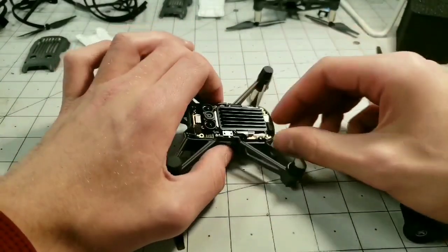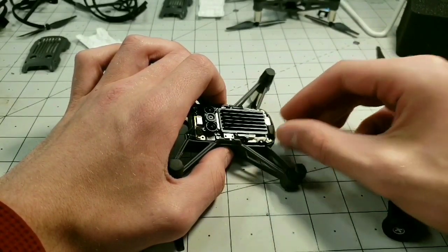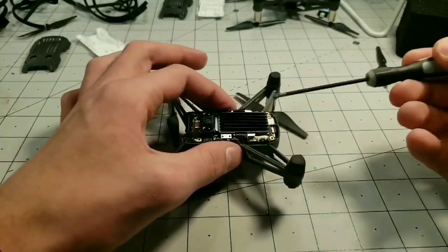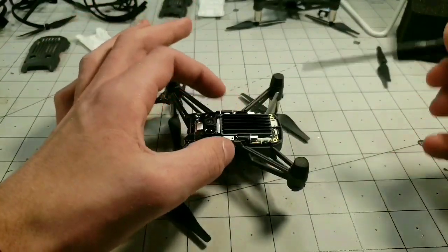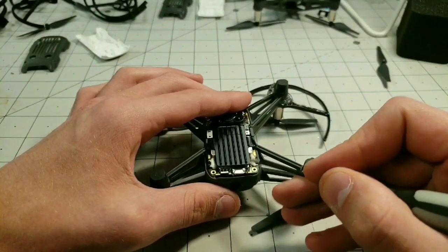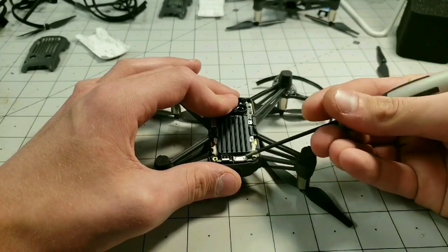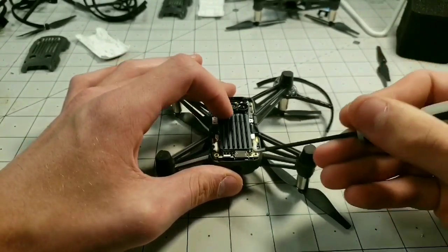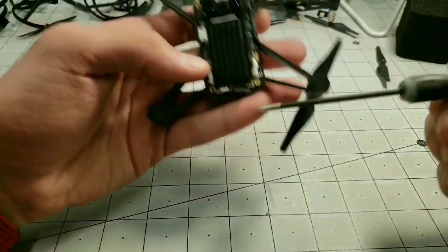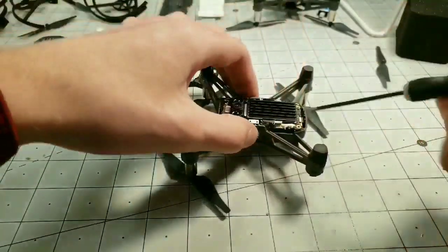Once you get that glue cleared, go ahead and take this little rubber piece that goes right next to the camera — it's a little electronic piece — and put that with your screws as well. There's a heat sink right here. The only thing we want to do before we lift this up is undo the camera so we don't damage it. That's also held on with a little hot glue, so we can just break that right off. The easiest way to do that is just kind of lift up on this little tab right here — be very careful with these, they are little ribbon cables and they're very delicate. So for the camera, you want to flip that up to disconnect it.